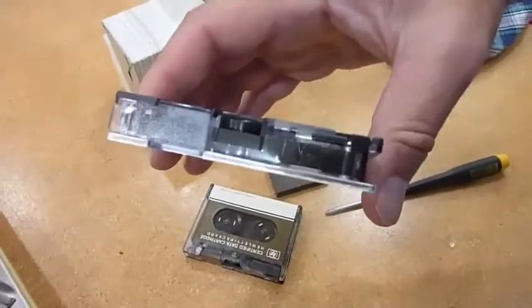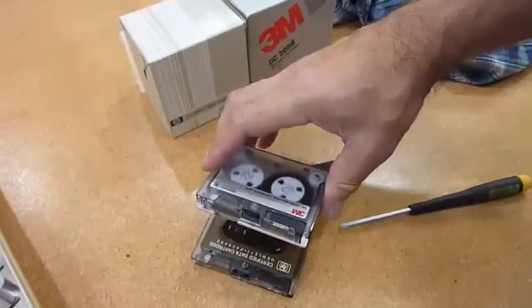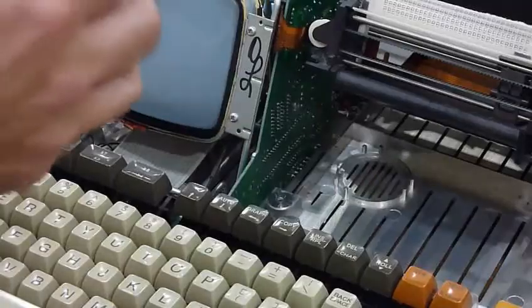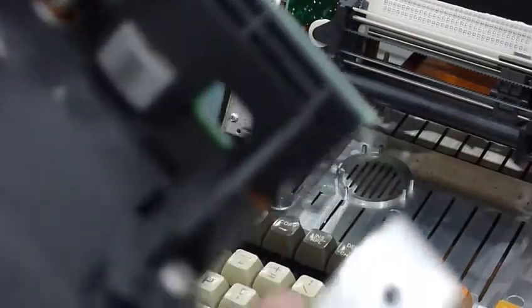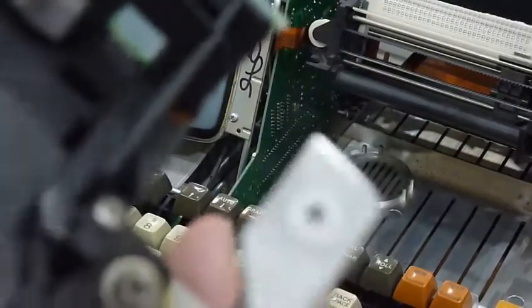It will likely go in, and you have to be able to have the capstan reach the wheel here, and do another small electronic modification. So we'll do all that. And you can see the issue here — the rubber on the capstan has just flowed away. It's transferring in complete goo.